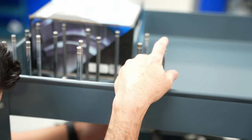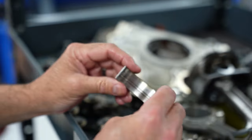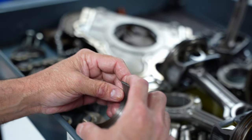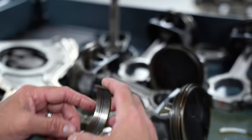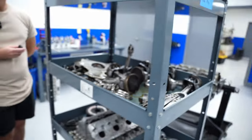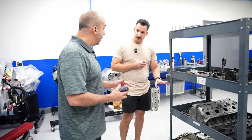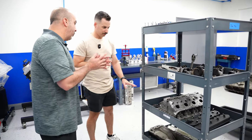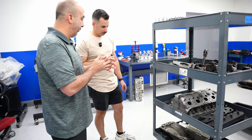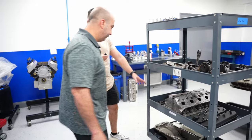Pistons we're replacing, but everything looked okay — normal skirt wear, it's okay. You did have some main bearings that were kind of shot. When you see a main bearing that's worn on the side, sometimes that tells you the crank is flexing a little — that's natural. The heads looked fine; they just need a valve job and pretty much that was it. When I bought it they told me the heads were ported from West Coast. You could see the CNC program — it's all dirty from one year back on the car.